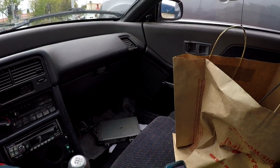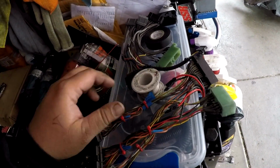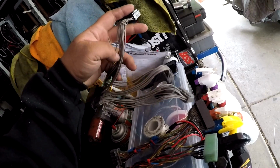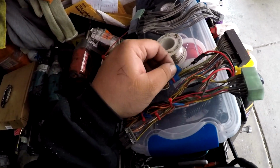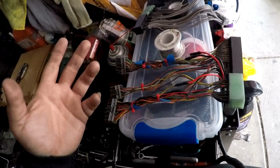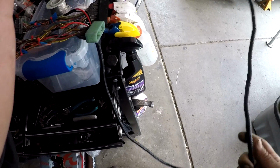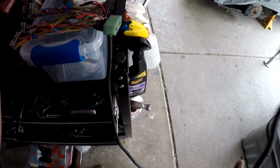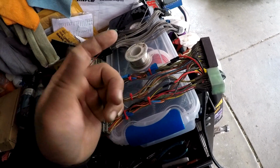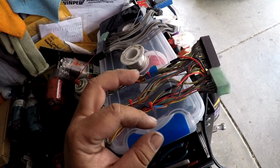At the post office, just shipped out the package for Tommy. Got the tracking number right there. So here's the DIY OBD0 to OBD1 ECU jumper, and this right here is a legitimate Rywire unit, and pretty much just based off of this, I built this, and all the VTEC, the knock sensor, pressure switch, and all that kind of loomed up, because my cousin's car is a non-VTEC engine, and going to OBD1, all he really needs is the O2 sensor, given that he's running a stock LS OBD1 ECU. So it's going to look for an OBD1 O2 sensor, 4-wire, and everything else is just taped up or zipped up. We're gonna try this on the car when he's ready for it. He actually got the motor in his car already, and is definitely moving forward with it because I know he is anxious to start driving his DB1 again.